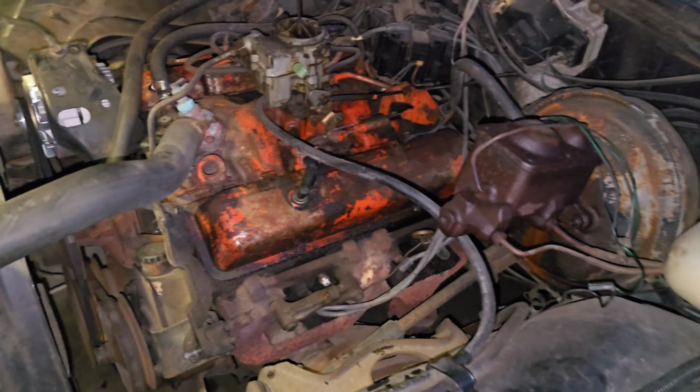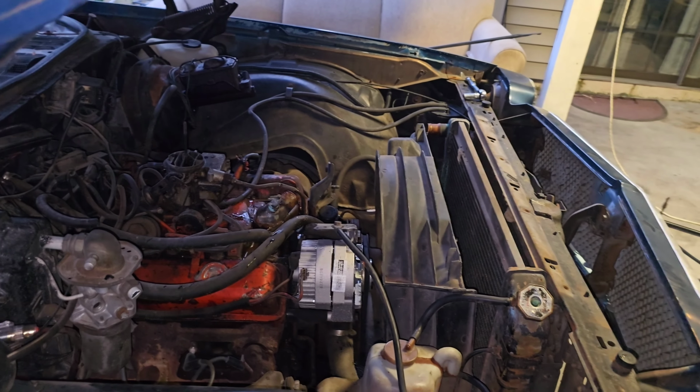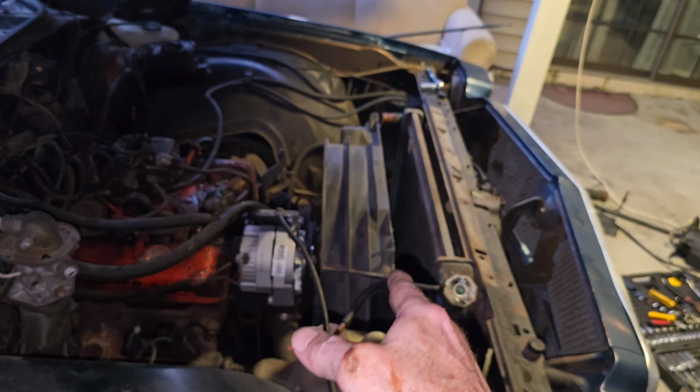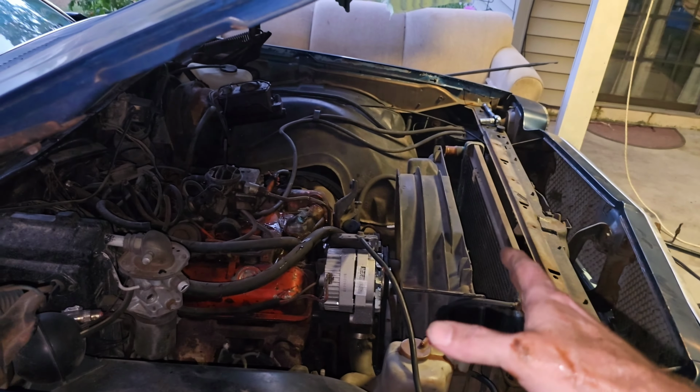So, all right, I'm going to go ahead and work on getting this radiator out of here so we can flush it as well. I think I'm going to start taking off whatever's not necessary up here. I had to wait until it got almost dark just so I could take the heat out here. It's just so bad. It's horrible. So anyway, let me try to get this bottom radiator hose loose without making a huge mess. Take the transmission lines off the radiator as well, pull that out, and then I can take the shroud out afterwards, because I don't want to take the fan off. I'm not going to go through that unless I have to. But if I take the radiator out, I can just move the shroud out of my way and put it back in when I put it back together.